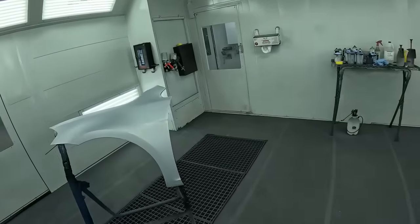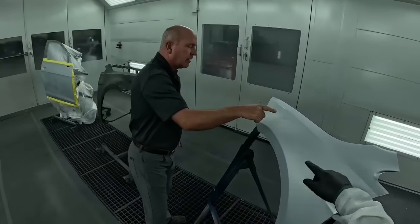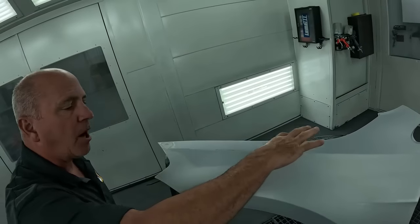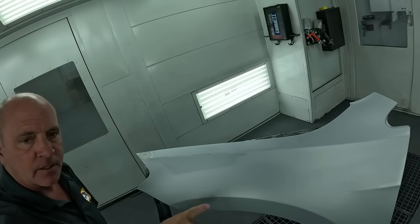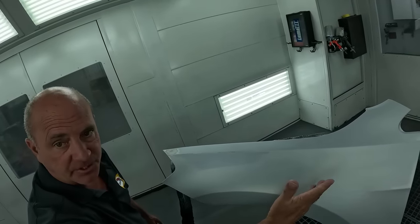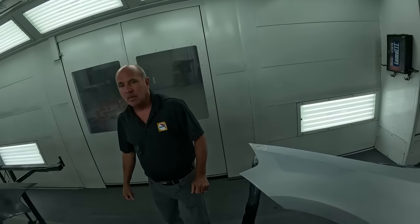Sounds good. So if you had some primer on here. There is primer here actually. So 541-5, I don't really want it on our primer, because it lifts the edges. It's aggressive. It'll lift that edge a little bit and you'll see it. So waterborne this then if you got primer there. Because you already waxed and greased this before primer, correct? Yes. Yeah, I usually wax and grease first. And then when I'm in the booth, I use straight water usually.